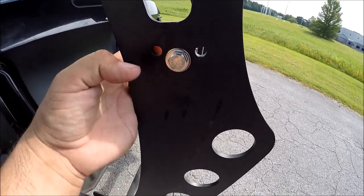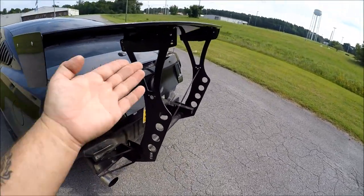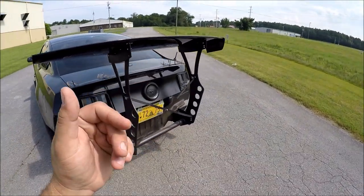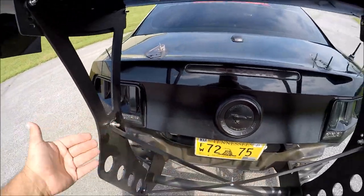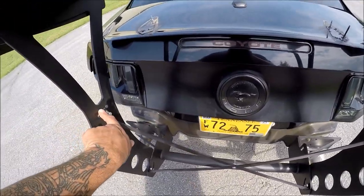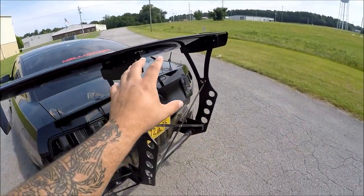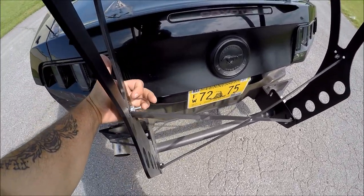They had little weld metal pieces in the holes that the actual screws wouldn't go through. So I had to take a rat tail file and file down a bunch of these holes right here because the construction on this thing was horrible. And some of the holes that all these studs or screws are supposed to go through — they just weren't big enough. Some were getting stuck; one hole would go fine and then it would strip the screws. So you have to drill out all the holes one by one, a little bit bigger, because they didn't make them the appropriate size.